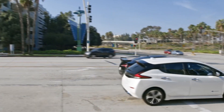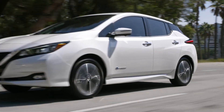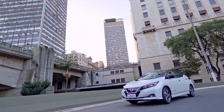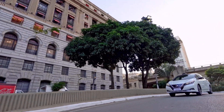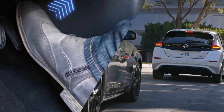Let's talk about the Nissan LEAF firstly, because although other cars have one-pedal driving, it was Nissan that coined the term e-pedal when they refreshed their LEAF, and that phrase has started to become synonymous with one-pedal driving. Nissan were rightly proud of their system. Previously the LEAF had two modes of regen braking: D mode, which is a bit like coasting, and a stronger B mode where letting off the accelerator would make the car slow down quicker. But with the e-pedal button engaged, very strong regenerative braking would slow down the Nissan LEAF, and when you lifted off the accelerator, the car would slow down immediately.